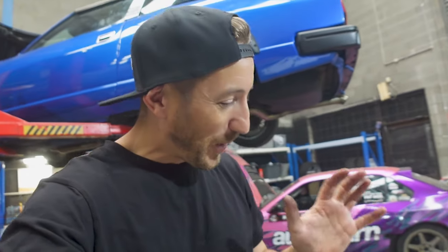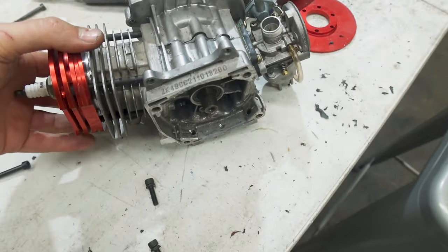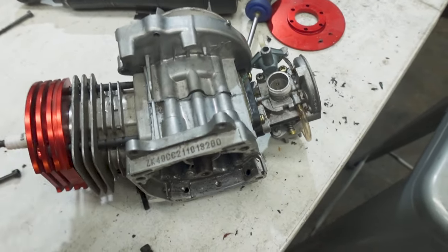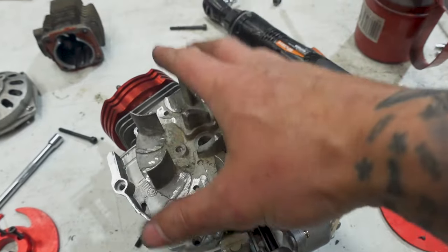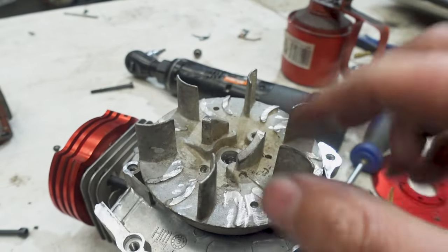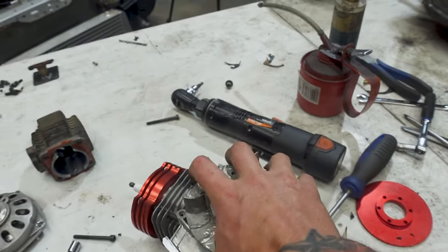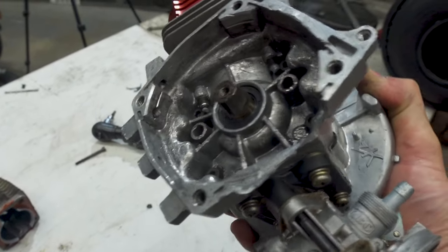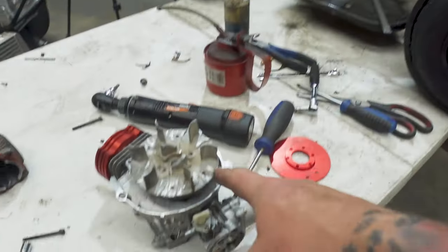We've made fantastic progress with our built motor — look at this! I love these because they're just so easy to work on. Honestly, if you're thinking about getting one of these carts and getting into the automotive world, I highly recommend it — it's so satisfying. Look at that lightened flywheel. I went pretty ham on it, but I think it's going to work well. I reckon we've left just enough fins on there. The amount of weight we took out of the flywheel is quite dramatic. Now we're going to pull the old motor out of the cart and put the new motor in.